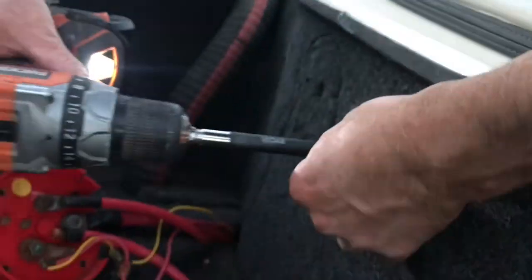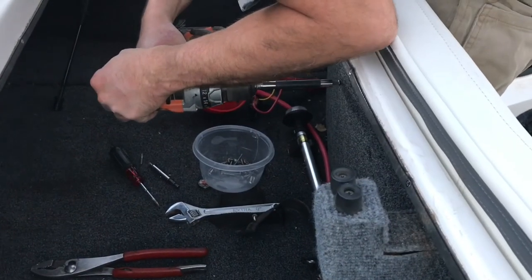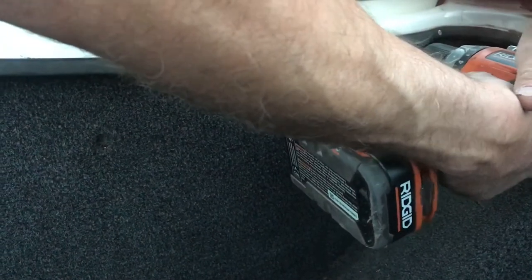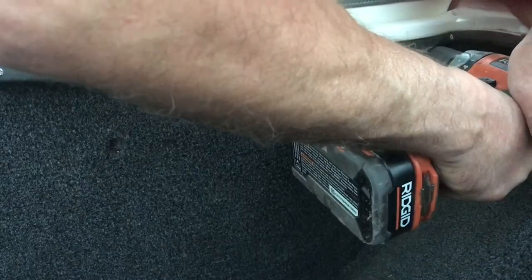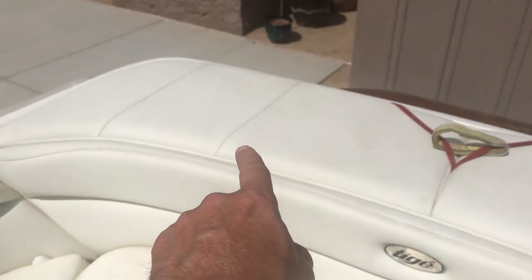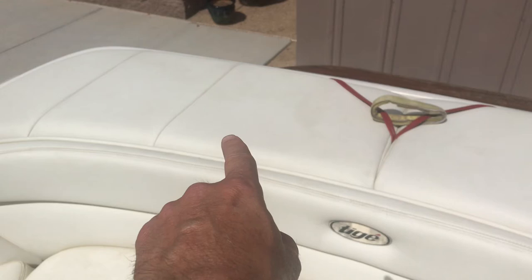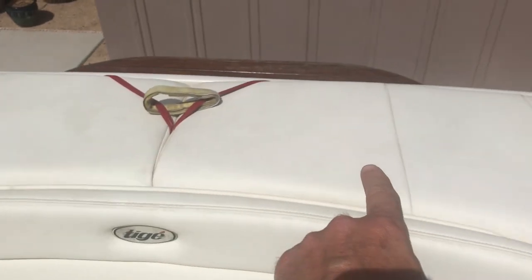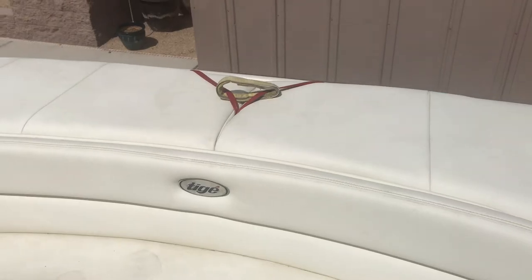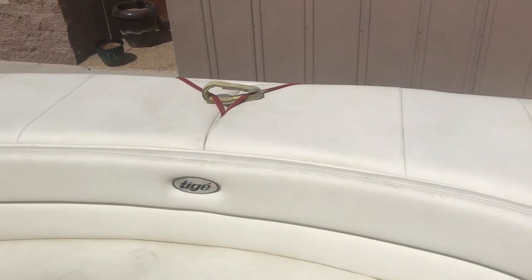On this panel, all the screws were held in from the back side underneath the panels. The back cushion was by far the easiest to take in and out — the only thing I had to do was remove the battery shutoff to access a couple of the screws underneath it. One thing to keep in mind on boats, especially older ones: they use wood a lot and the wood can rot out, which could lead to extra costs. I had to use a slightly longer screw at an angle to get them to bite — just make sure you can't feel them with your toes so you don't puncture the upholstery.